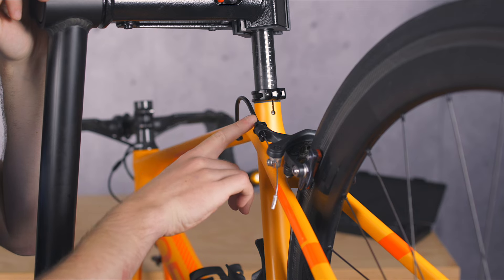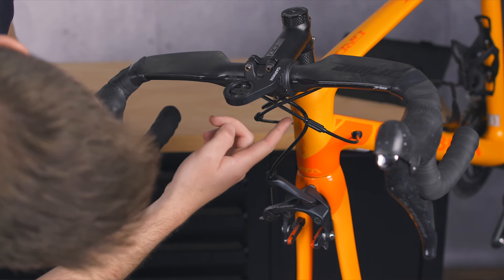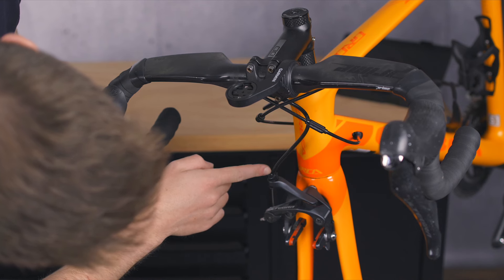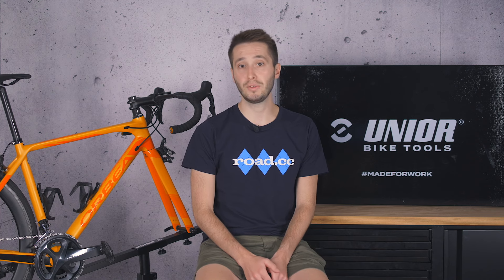Cable run optimisation has always been one of the most important factors when setting up brakes — for a long time I used cantilever brakes on my cyclocross bike and they really needed perfect length cables to create as little resistance as possible. We need to give enough cable housing to allow the handlebars to turn freely while also creating the smoothest line possible from the hood to the brake. We also need to avoid really tight bends and make sure the ends of the housing are free from obstructions. Simply go along the length of each brake's housing and check for very tight bends and kinks. If your brakes are heavy at the lever, consider replacing the housing and the inner cable because that will be bent too.